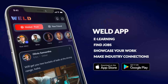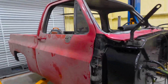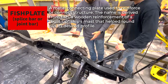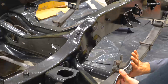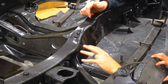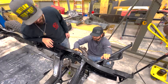So you've got this whole Blazer just taken apart — what led you to even get this far, down to the bare frame? Yeah, literally this truck only had an oil leak and the windows didn't roll up or down. The more you dig, the more you find. First things first is this fish plate — that's what you call it. It's just a reinforcement term. This is a known weak point in the K5 Blazers: when you run oversized tires, the gearbox puts a lot of tension right here and these frames crack. Luckily this frame wasn't cracked already, so this is sort of just preventative maintenance.